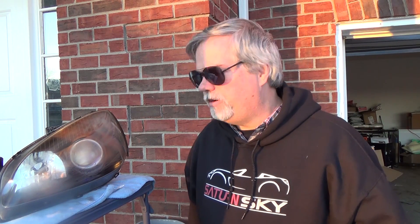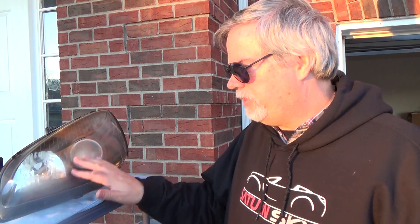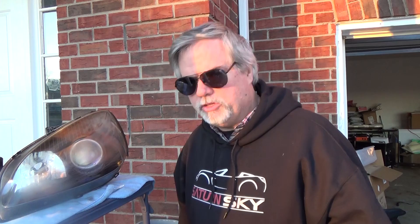So I put three coats of the clear coat on there and I wasn't 100% satisfied — it had some little pits and a couple of things on there. So I went and took a 1000 grit wet sandpaper, sanded it down one more time, and now it's nice and smooth again. I'm going to put another couple of coats on there and hopefully that does the trick.